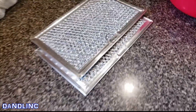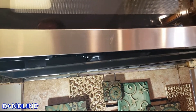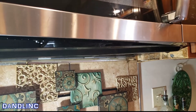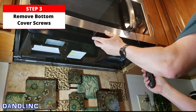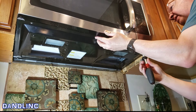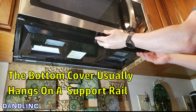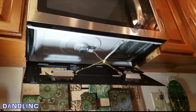I already took out the two filters so they didn't fall out everywhere. Using the screwdriver I'm going to remove six screws — they're just sheet metal screws. I already removed most of them; here they are. When you remove the last screw, just hold your hand here so this thing doesn't swing down and smack anything. It sits on a little ledge that'll support the weight, and there we go — not too terribly heavy.